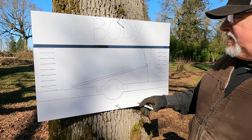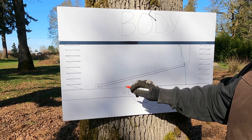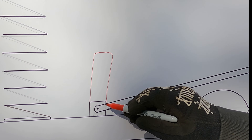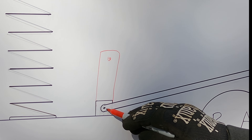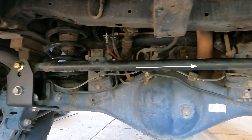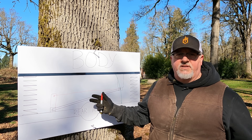To correct that, when you lift a vehicle, you need to bring this back into alignment. What we're going to focus on today is a correction kit. We're going to take this bracket or mounting point and move it up here. You can see once it's up here, this bar will be flat. So do not lift your 4Runner until you consider things like this.